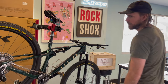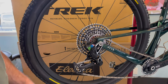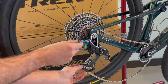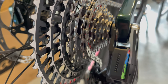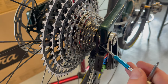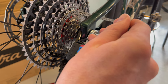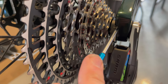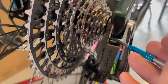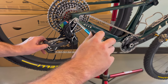One thing we've already talked about is the paint on my bike being a little thick, which is a good thing. You can see how this piece does not move forward with the derailleur like it's supposed to. So I'm going to grab it - and now we're perfect. You want to line up these two lines: there's a notch in the silver part and then there's a line, and you just want them to be lined up. Then go ahead and snug it down.